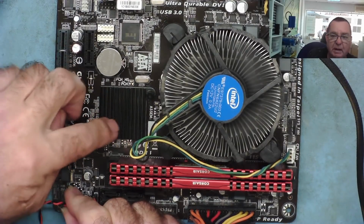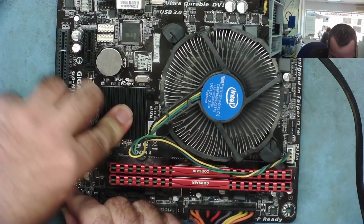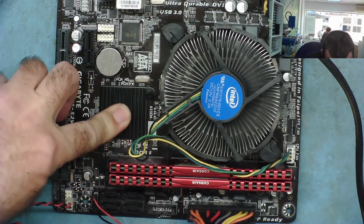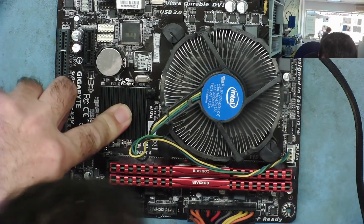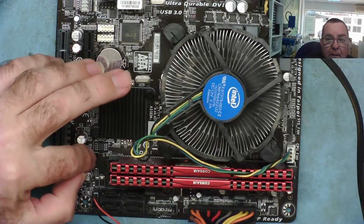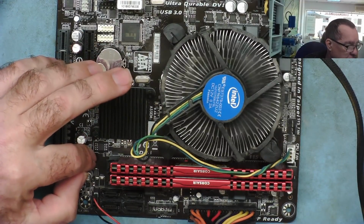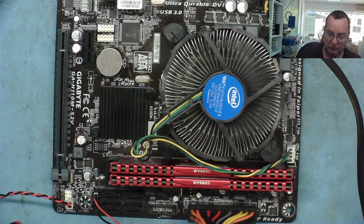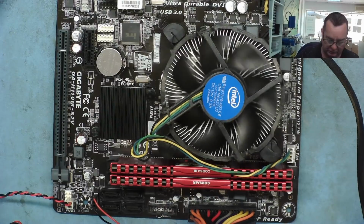I think this is fairly typical of a PCH problem, but we can maybe have a look. Or it could be a BIOS problem. Worth a try. BIOS is here, so we could try BIOS. I mean, I'm pretty sure all the voltages were up because it actually got some bleeps when there was RAM not fitted, yeah. So it's definitely doing something.